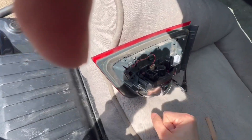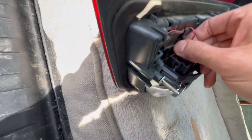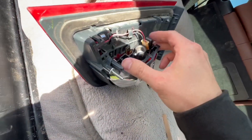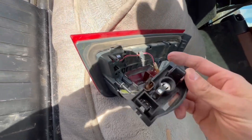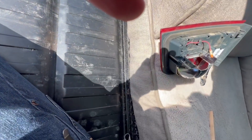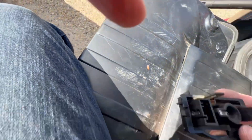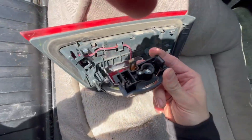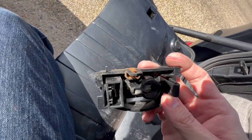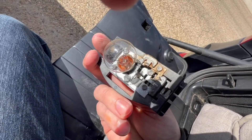The LED portion of this light is what went bad. What you'll see here is this goes to the LED board. You squeeze this and it'll come up. I actually had to pull it out. What happens is this sits in there like this, and it looks like there could have been a leak — it's only on this side though. The water pours in right there, which broke the pin for my LED connector, and then it leaks around to this side.